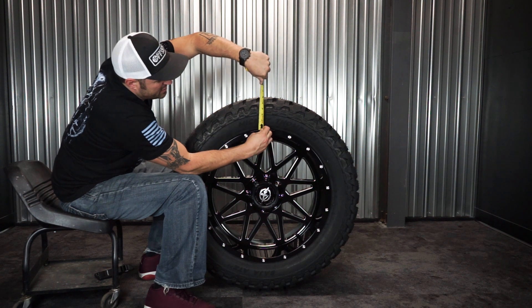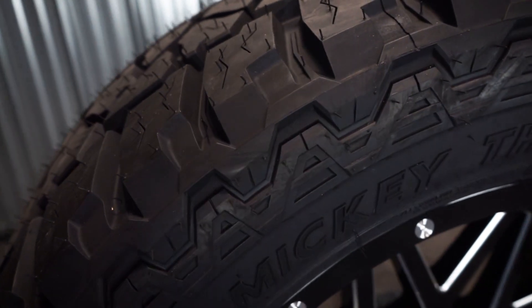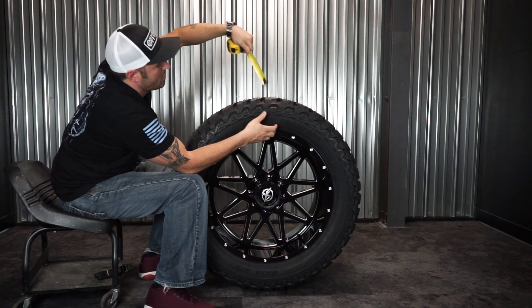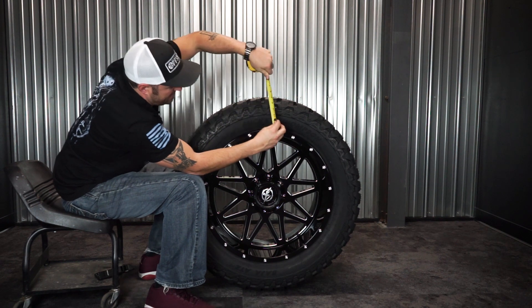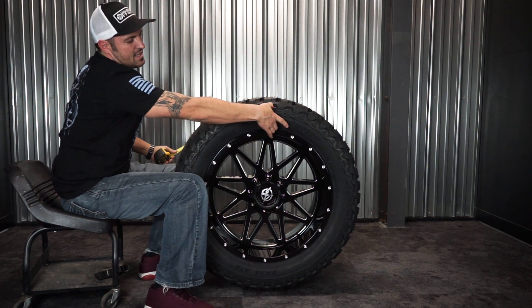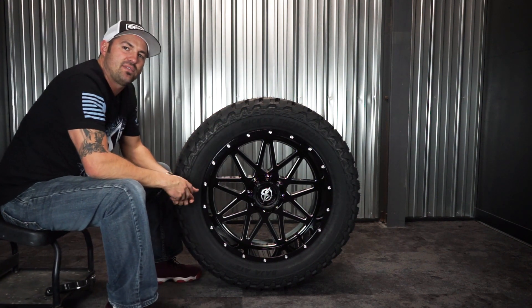Because it's almost 35 inches tall on a 22, you'll have a little more sidewall in general — it won't really give you that low-pro look. It's probably right around five and a quarter inches tall to the top of the lugs, and coming to the tread seam, it's about four inches of sidewall itself. So that is your matchup on the 22 by 10 on a 325-50R22.